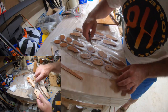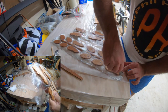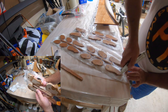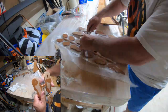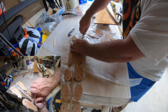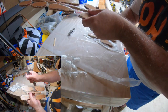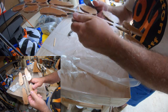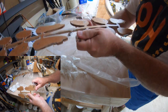The hinges on the galley hatch go on around the same time as the ones on the doors. The hinges get a layer of fiberglass on each side. As usual, the holes will probably fill with epoxy. They come on a handy little frame from CNC machining, like those model airplane kits you had when you were a kid. You can cut them off or leave them on the frame until after you've done the fiberglass, like I did. Don't leave them too long before you cut off the excess cloth. Trimming around those small shapes with hardened epoxy and fiberglass cloth is challenging.